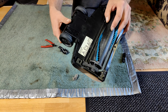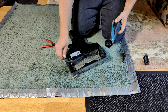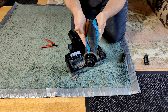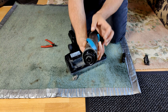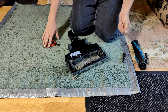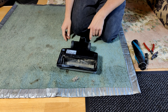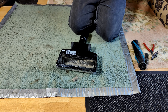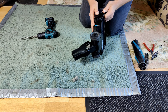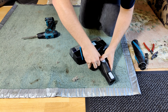This is possibly the beefiest cordless power head for a cordless vacuum that I've seen. Look at that big old toothed belt. And here is the brush roll, though I cannot help but notice that it brushes the way of the angle, so I don't think it really pulls the pile up. Whether that's intentional or not I don't know. So we have the brush roll out. The next thing to do is to undo every single screw on this floor — I'm assuming one part is going to come away from the other, usually the lid that does this.